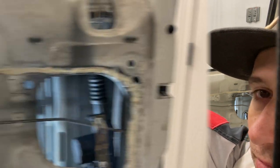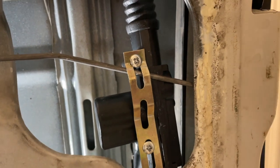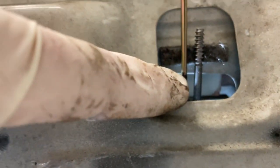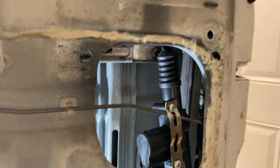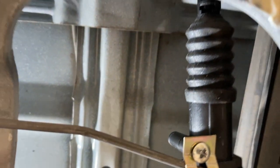I've got the door actuator mounted. I had to do a custom bend around the interior rod back to the door mechanism. We're pretty well centered up with the actual lock/unlock switch. I've marked where I'm going to pull the rod out and cut — you basically want to cut below the threads, as we'll need to thread down the plastic cover for the top of the lock mechanism. Double-checked that it clears — some of that will tighten up whenever we tighten the lock mechanism.